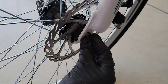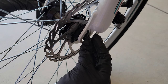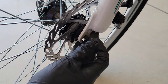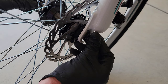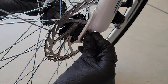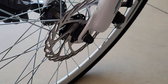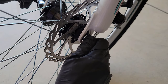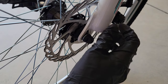On this side, we put the lock washer on, then put the spring on — same thing, the spring does need to go in a certain direction. It's the small side of the spring that goes in towards the bike. Then the adjustment nut goes on and we tighten it up until we have some resistance. Then we test the quick release lever side: if it goes in too easy, open it back up and tighten the adjustment nut some more until the quick release lever shuts with good tension, to make sure the front wheel is on there secure.